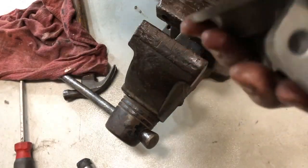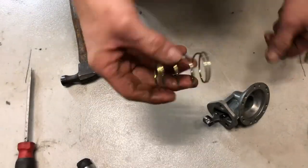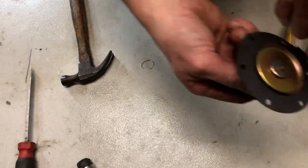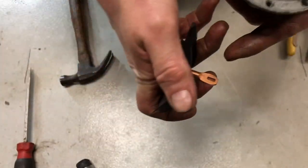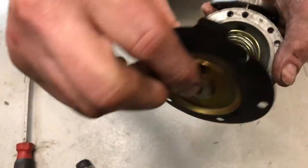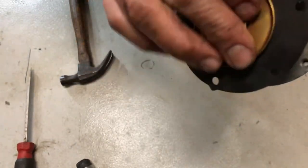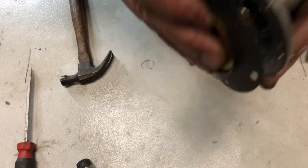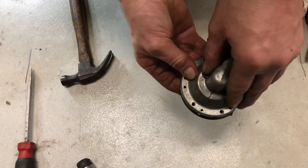Before I forget, I'm going to put a little bit of oil on it there. Next up would be the spring and the diaphragm. This little hole here has to catch that hook inside there. I'm doing it like this — turning it over and letting that little hook drop down.